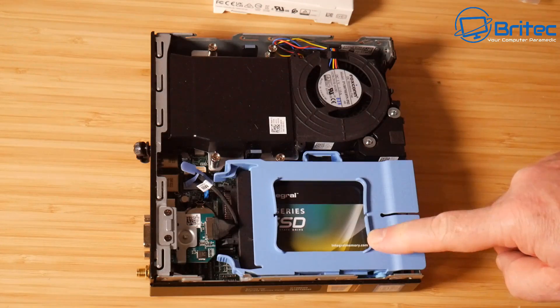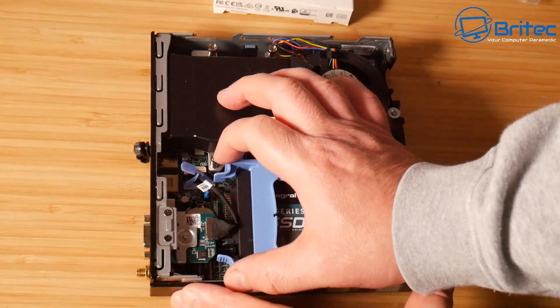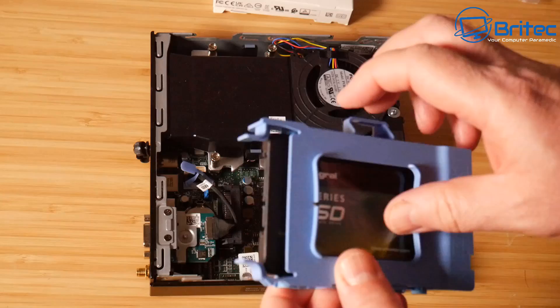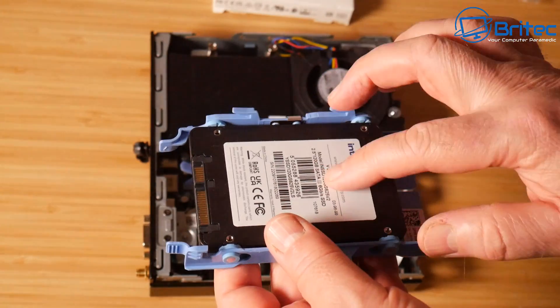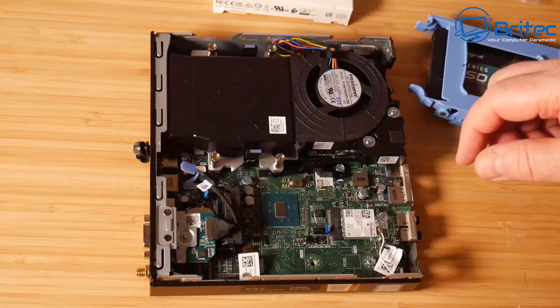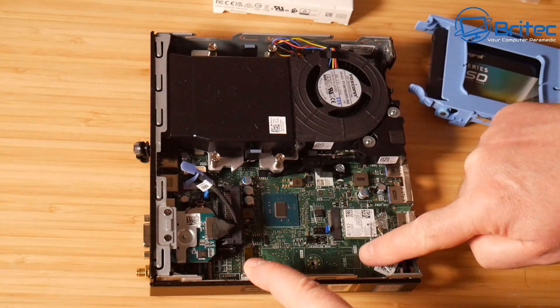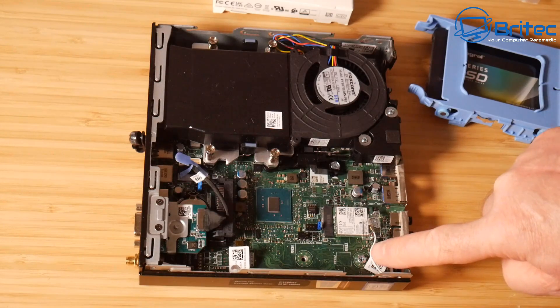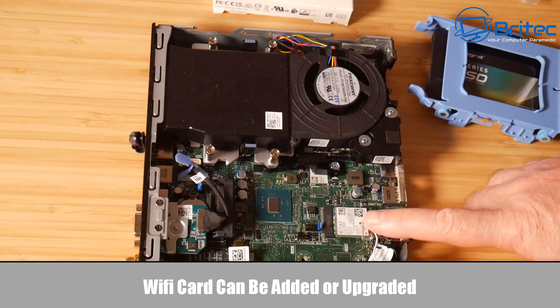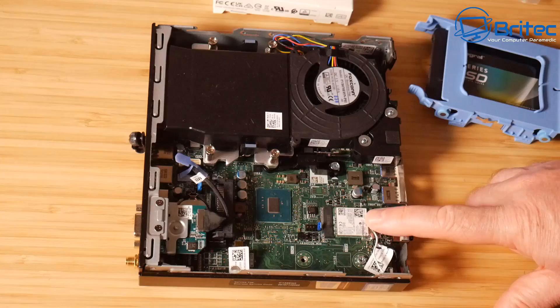If your unit has a mechanical drive, those are great for storage — so if you've got a one terabyte mechanical drive you could leave it in there for files. This one has a cheap 128GB SSD which I'll change out; it should have had a 512GB SSD but the previous owner swapped it. There's a slot here for your NVMe — it does need to screw in, and if it's missing the mounting screw you'll need to get that. There's also a Wi-Fi card in here which can be added at a later date.